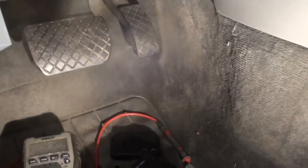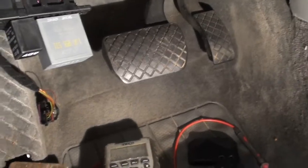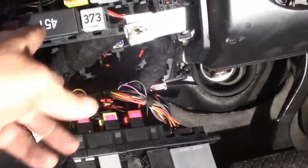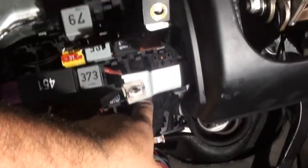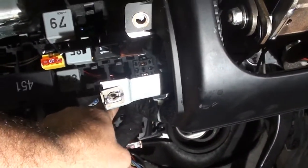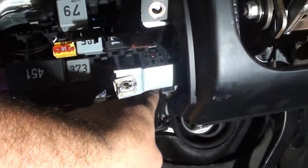People were telling me that that TCU over there on the floor could be bad because it keeps thinking it's in neutral or drive or whatever. One guy told me to go to position 12 on these relays. Well, position 12 would be number 2 from the right, but it's missing. That is because they moved it over to position 13 because it was easier to get to.